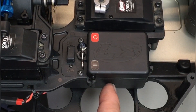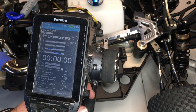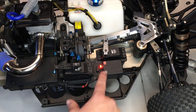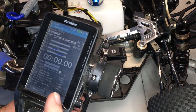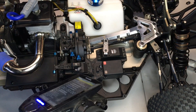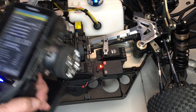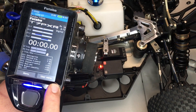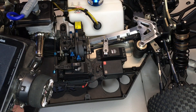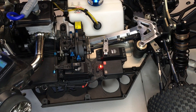With your transmitter turned on, turn on your car and verify that the LED is lit up. You will need to program a channel on your controller. As you can see, I push the switch and it turns off the LED light. You also want to test it by powering off your transmitter — you can see that it's now blinking, which means it will cut your engine. As soon as you turn it back on, it lights back up again.